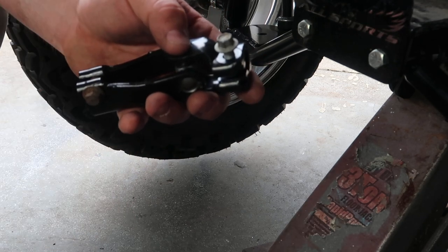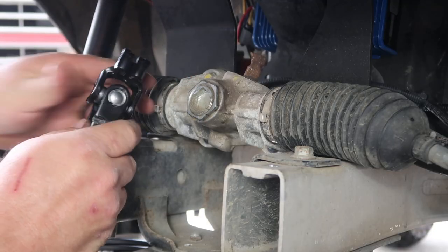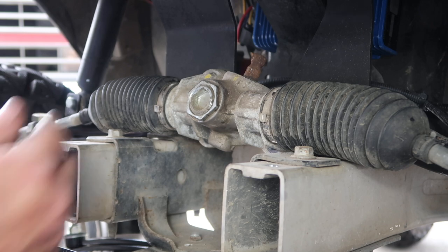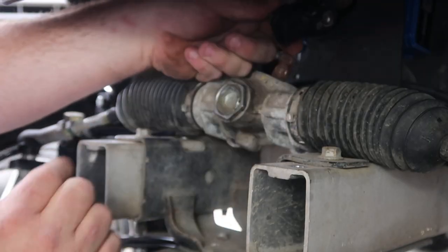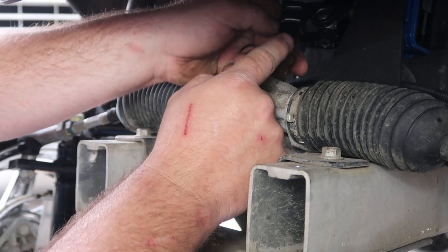So we're gonna use those in here as well. Now when installing the yoke back onto the steering shaft, I have the tires lined up. We need to line up the steering wheel itself so it doesn't turn. First of all, I'm gonna slide the yoke onto the intermediate shaft, turn it, and look at it from here because I'm by myself doing this. Before we install the yoke onto the rack and pinion, there is a flat spot on the back of this — so this is only gonna go in one way.